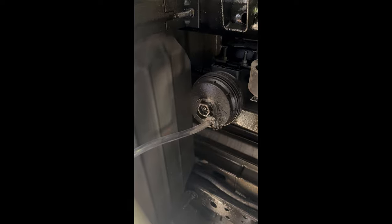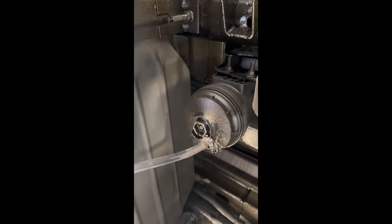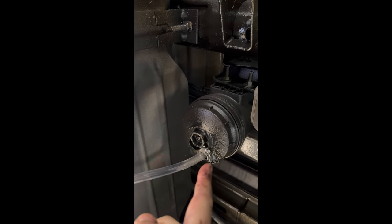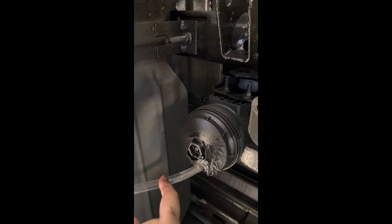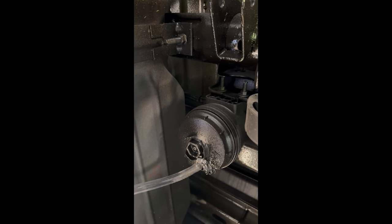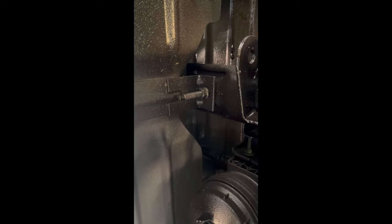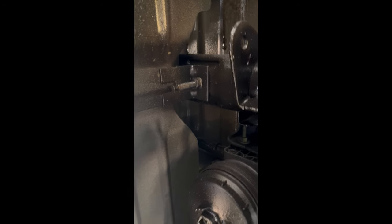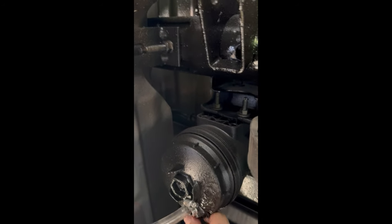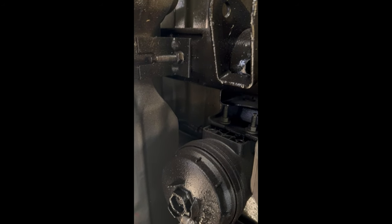All right, now for the back filter, I got this plastic tube. It's gonna come down to this jug. And I got it wire clamped onto the nipple. This is a 3/8 inch inner diameter. You could probably do 1/2 inch and get away with not needing this. And then we gotta crack this bleeder here open. You should open it up.